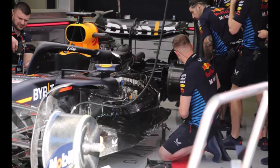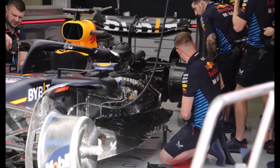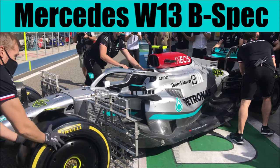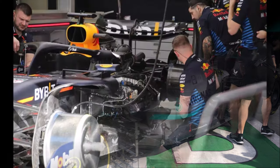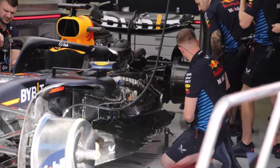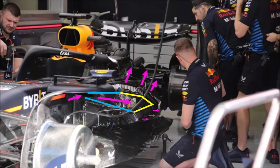There is a great shot by Giorgio Piola where we can see the RedBull without bodywork. The whole discussion about Mercedes-style zero pods is a bit misunderstood — Mercedes never had no side pods, they were just very narrow at the top. The RedBull side pods are really full. We can see an interesting new-old cooling system: the V package. There is a large radiator lying at the bottom, which could be a water radiator. Above we see a double package — these could be oil radiators. In front we see a thin possible water radiator first, and a thicker core behind it, so this could be an air-to-air intercooler.